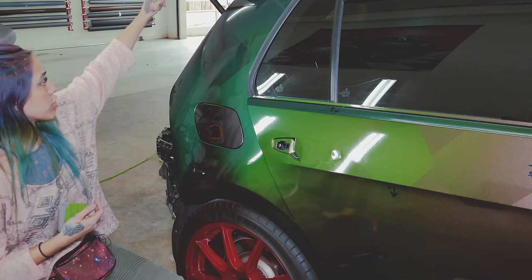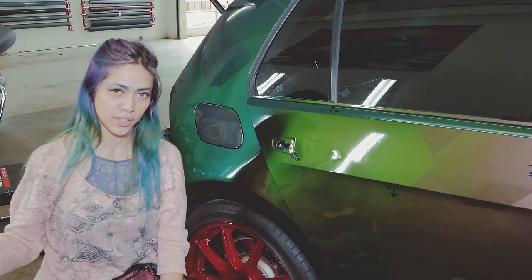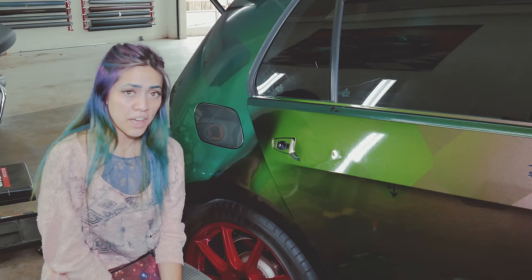So you want to make sure all your panels down one side are all facing up. When I do my other side I make sure they're all facing up. The bumpers and the trunk I make them all face up, as well as the hood — the hood will face the roof. And then when I do the rooftop I usually make it match with my driver's side, so the up would be pointing towards the passenger side. If you guys want to hear a little more technical information on directionality, all of the material manufacturers will mention it if they have cool colors — you can definitely check out Avery's link, I will post that below for you guys.